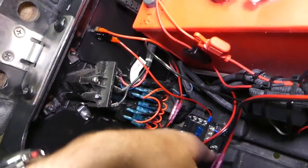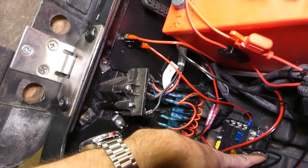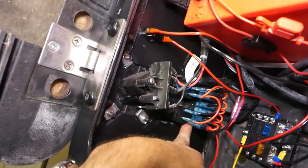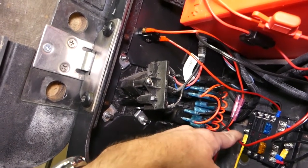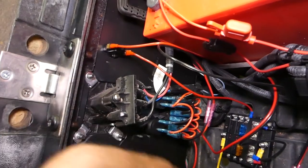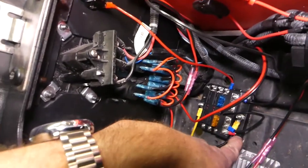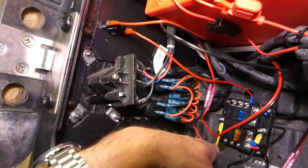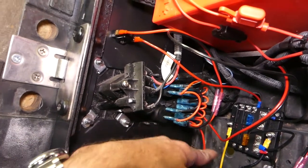So to summarize: power out of the transformer to your battery — two power leads, negative and positive — to the fuse box. The fuse box then fires up your switch box, and on the other side of the switch is where you plug in the positive from your windshield wiper or whatever it is you're doing. The negative goes to the block, the positive goes to the switch. That's how that works.